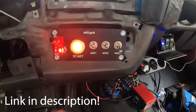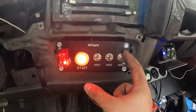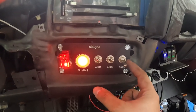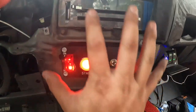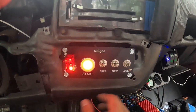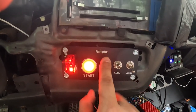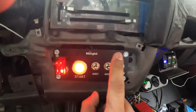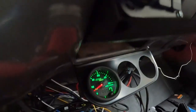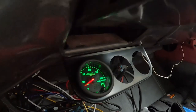I've been loving this switch panel — it's making everything real nice and easy to get to. I only had to sand just a tiny bit right here to get it to fit, and a factory cover will still fit over this. I've got a master power, my fuse panel, my gauges, and this is the fuel pump switch. Down here I have a quick voltmeter, and this is actually the pressure gauge — we've got a nice 7 PSI, and that's perfect.